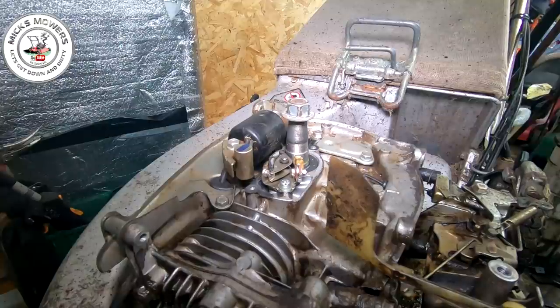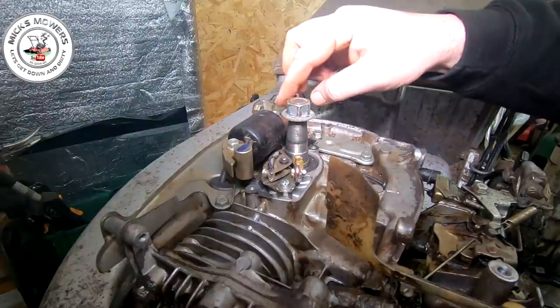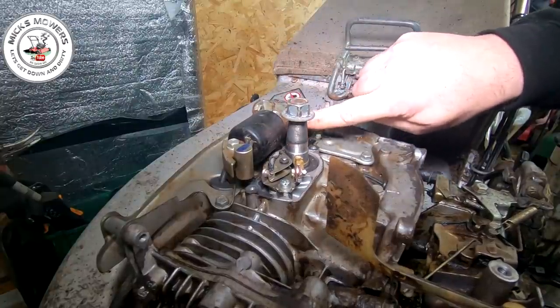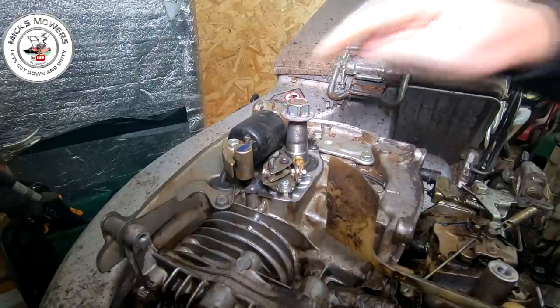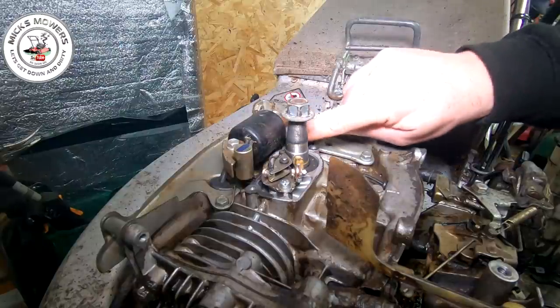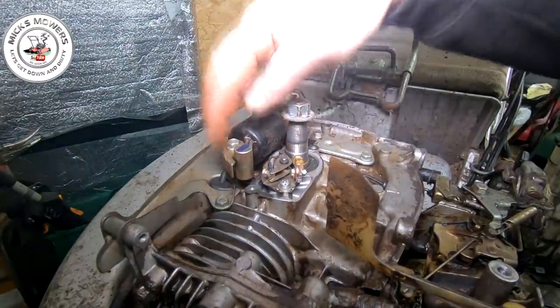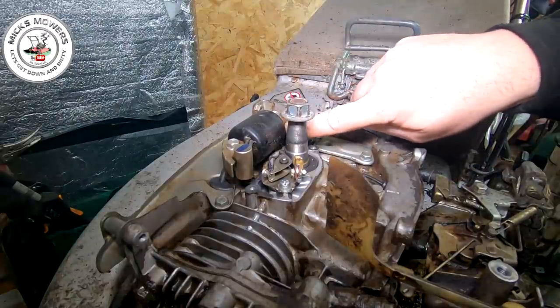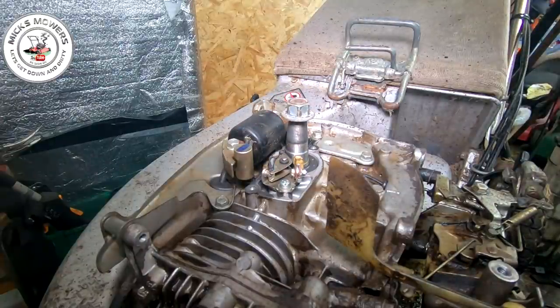Next I'm going to remove this coil. This is a fixed core — we can't adjust these — but I want to clean this surface edge up here, and I also want to clean the flywheel because it's got lots of dust on it and if you're not getting the air gap that's not going to help either. Clean it up — one bolt here, one bolt there, that'll lift off — then just clean up with a wire wheel on this edge here, and also clean around the bolt holes and the post it sits on, then refit it back onto the machine.